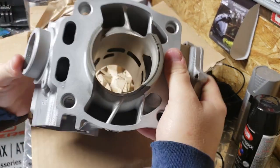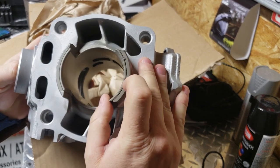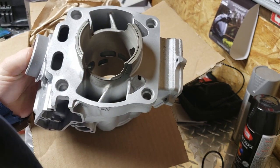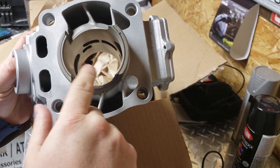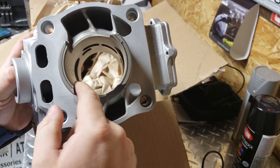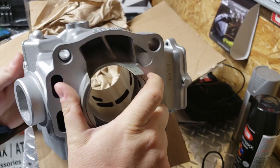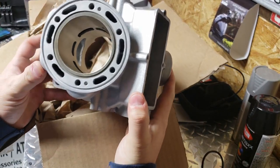What makes this one unique is right before I sent it off I noticed it had a steel sleeve in it, which really ruins the cylinder. I hate it when guys do that. But Power Seal was able to actually bore the sleeve a little bit and then apply a Nikasil coating right on top of it. They told me they have no issue with it — it lasts just as long as a regular Nikasil job, and it looks exactly the same.